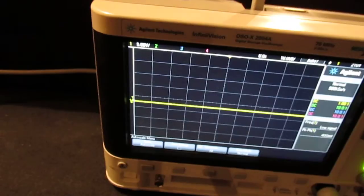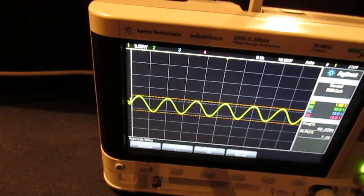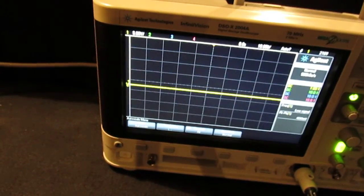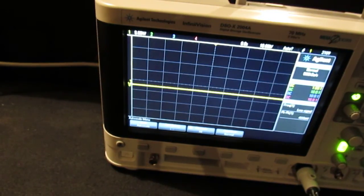And I don't know if you can see. I'll turn it sideways. What was that, 7 volts? My finger's slipping. There we go. Now I can hold it and show you at the same time. Okay? So that's what my amp likes. So after you set that for both sides, which should be pretty close to equal, I'm going to go ahead and go to the other side.